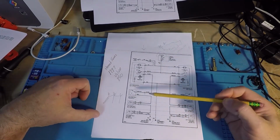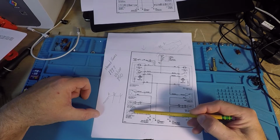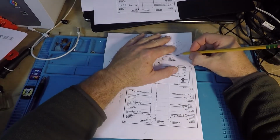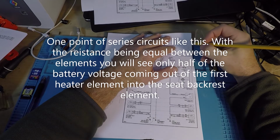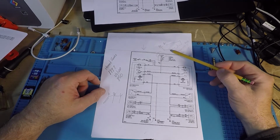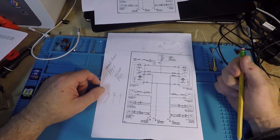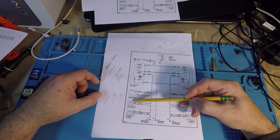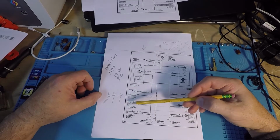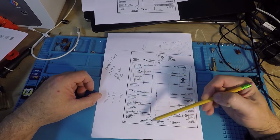We'll find out today. So if the seat heater bottom is functioning, you'll get power to the seat backrest. If it is functioning, then the current will flow to ground. So just like this, B+, and this is bottom. All right, and then this will be the backrest. It's going to go in this to the load, and they're in series, and it goes to ground, which is going back to the battery. So you have a loop. That's what you need. So in my case, this one is showing up as no continuity. So in other words, there's no way for the current to flow through it, so that takes out the seat bottom and it takes out the seat backrest all in one fell swoop. No matter if I've got power, everything's fine.